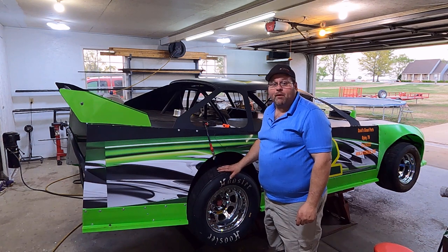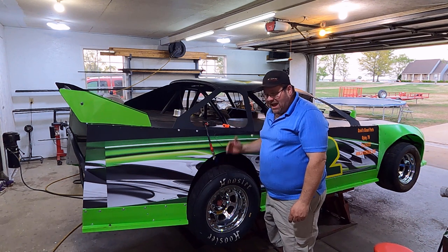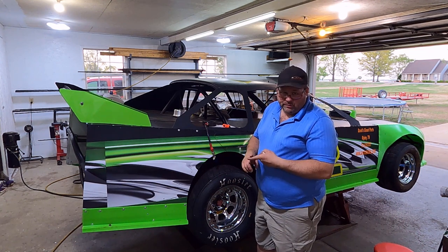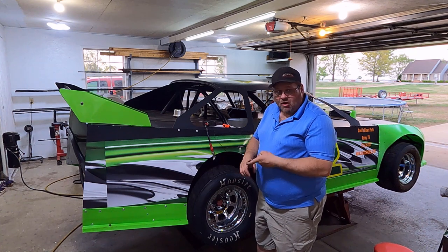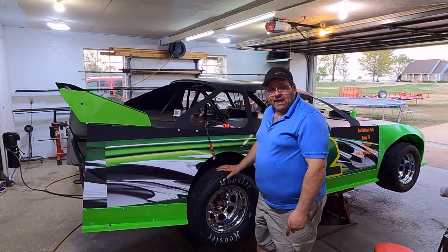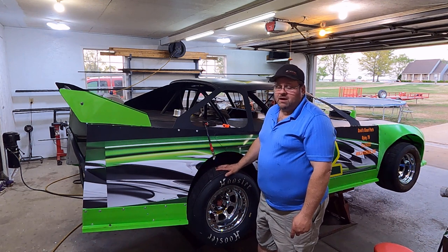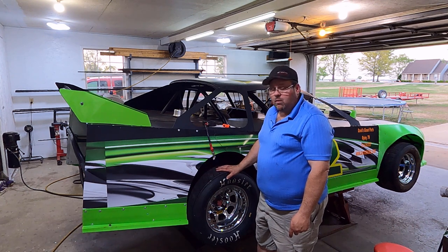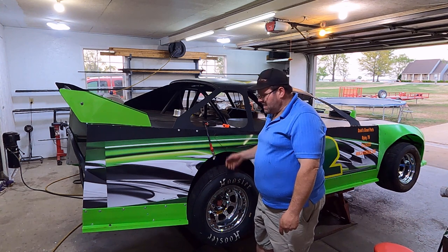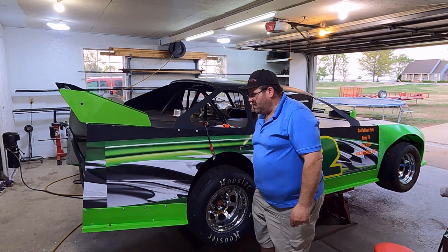The first step is always scaling. You can get yourself in trouble if you're mounting tires you haven't mounted before — whether asphalt pull-offs, new Hoosiers, American Racers, or whatever. Try to mount those up a different night from when you do this, because if you mount them, set the air, and then scale over two or three hours, that tire will change and grow after it's been on the rim. Mount them one night, then do your scale the next. Make sure to go back, set your air again, and check your stagger right before you scale.